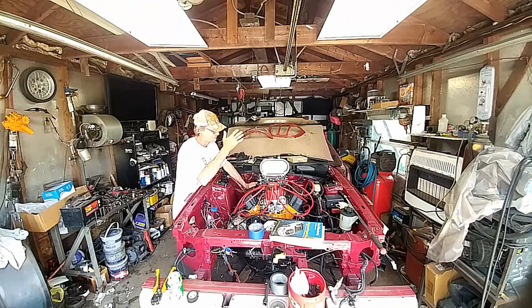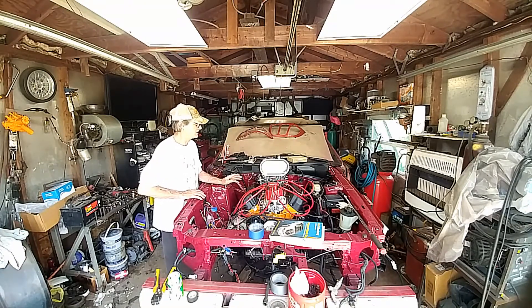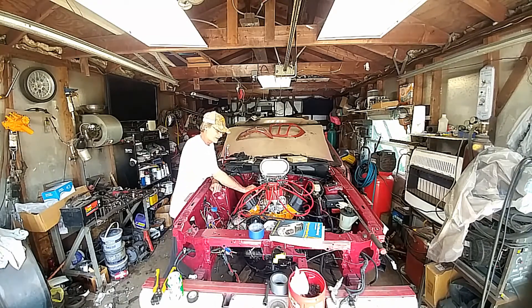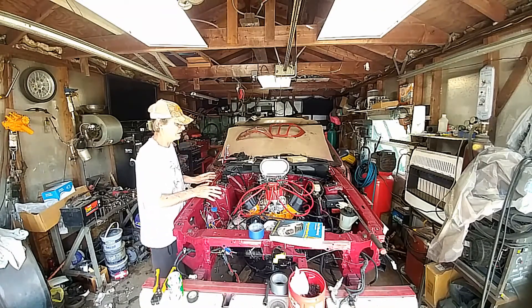We'll post links covering intake, water pump, and basically everything to build your motor — your rings, your pistons, stuff like that. What we are doing is showing that this can be done with the SN95, the latest models with the 4.6. This motor has GT40 heads on it, which come off of an Explorer — that's where you find GT40 heads. We have a '95 water pump on it; basically everything else is the same.